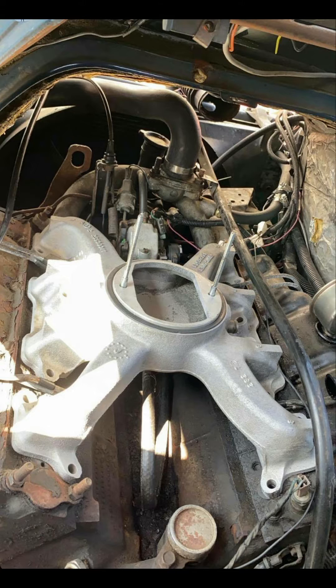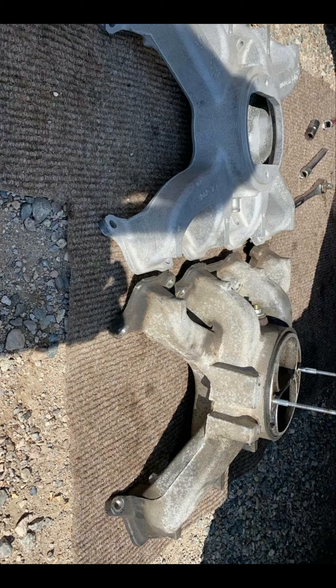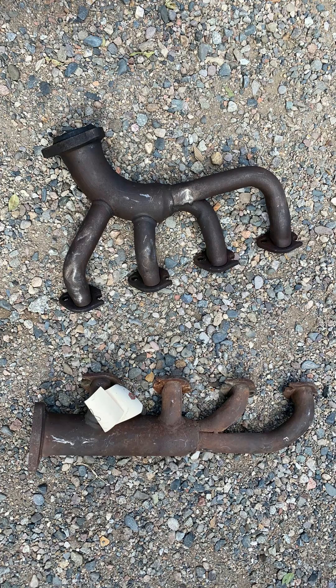But the intake manifold and the exhaust are serious upgrades for me. I put up a few pictures of the intake next to my old one. I don't think it matters too much with boost, single plane versus dual plane, since my air is now pressurized going into my engine. But the main reason I bought this new intake was the way the flange is designed — there's a lot more surface area where the top hat would meet, so it'll be easier to seal. The other reason is it sits a couple inches lower, which gives me more room under the dog box for anything I decide to add later, or more room to work in general.